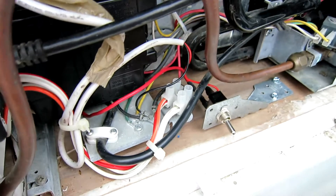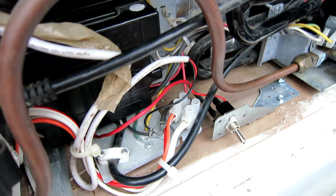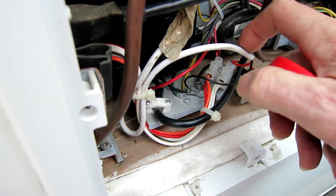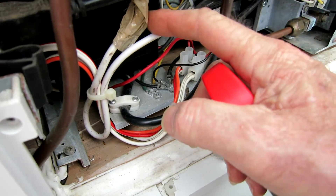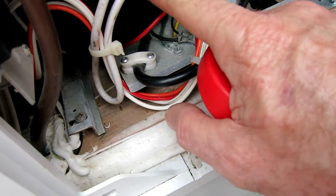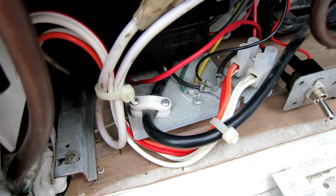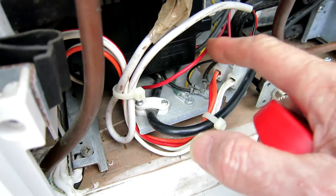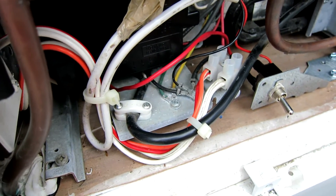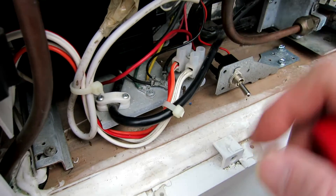Of course, I won't have a light inside the refrigerator right now, because this wire here goes through the refrigerator. One's ground, and now I'm running through a switch and back into the low control panel. J2 is the terminal — normally it goes straight to the heater strip and straight to the light, but I bypassed it, came over here, went to the switch, through the switch and back up to the refrigerator.